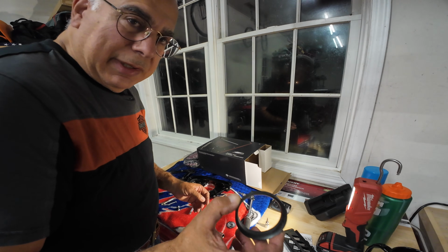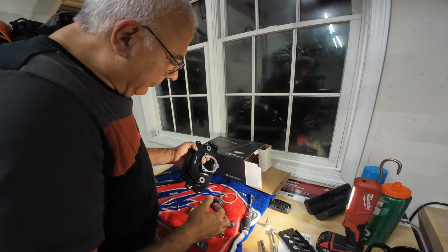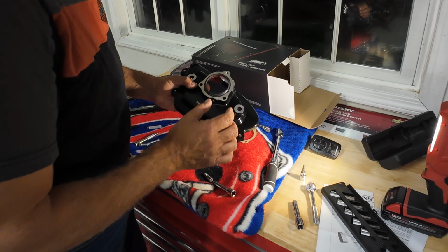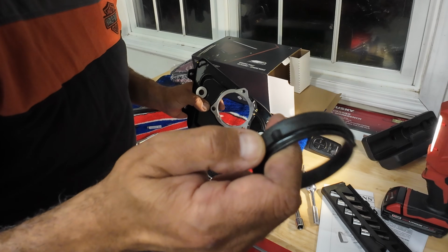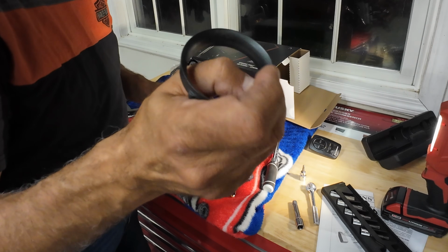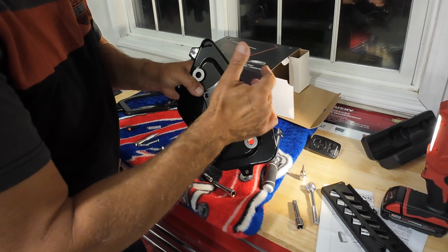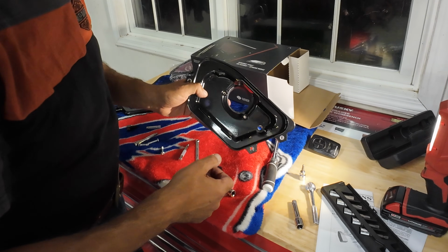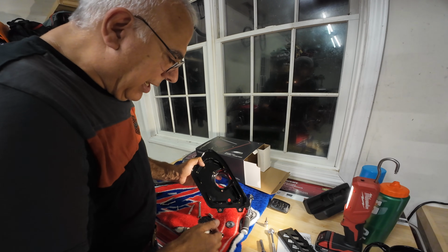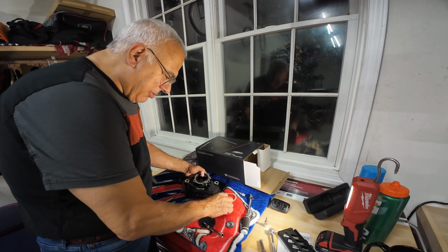This taper piece gets installed on the back side of the base plate to the air filter, and it has these nubs on them. On the inside, the side of this ring that faces out, it's tapered almost like a velocity stack, and it gets installed like that. It snaps in, and you can see that it's very smooth to guide the air on the outside of the bike, the air intake side of the bike. So that adapter ring's on there.